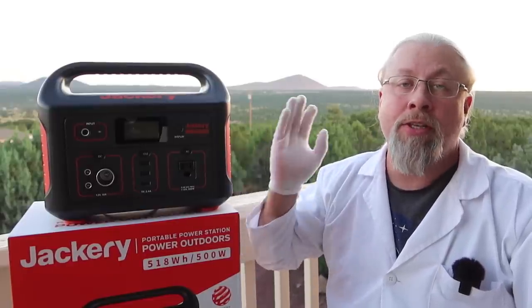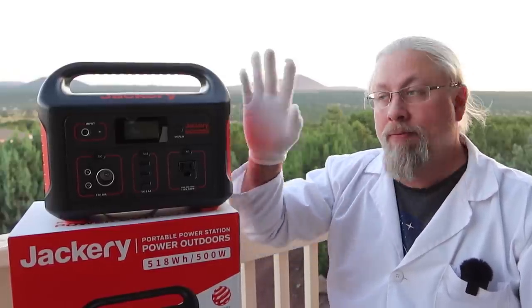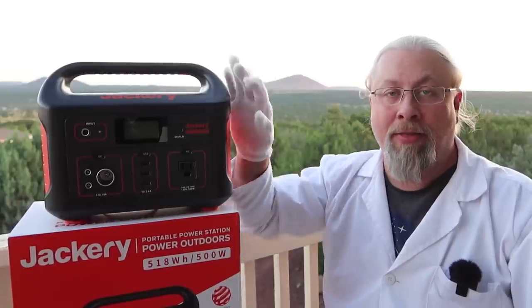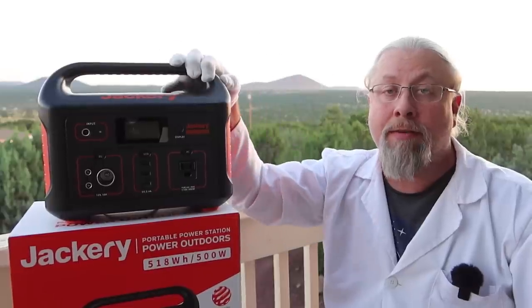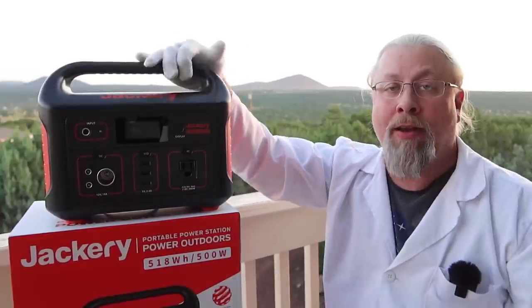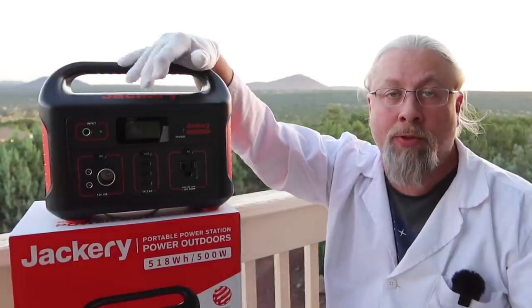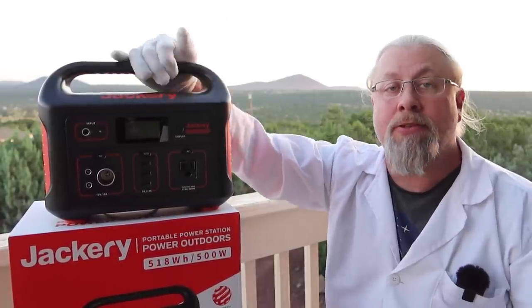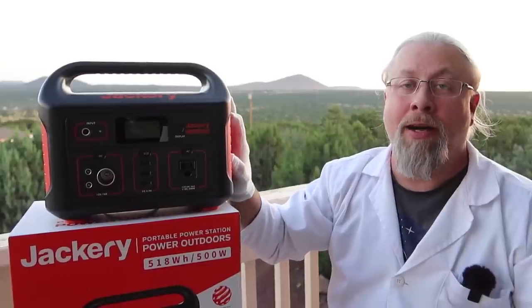What do I like about the Explorer 500? It's a solid product and the new MPPT charger is a very welcome change — no more of that wonky PWM charging where shading part of the solar panel permanently reduces charging until you unplug and replug. That's finally resolved. As always with Jackery, the 12-volt output is regulated and rock solid at 10 amps, with no problems running a CPAP machine or 12-volt refrigerator. And there's a secretly larger battery giving you an extra 50 watt-hours over the old model.